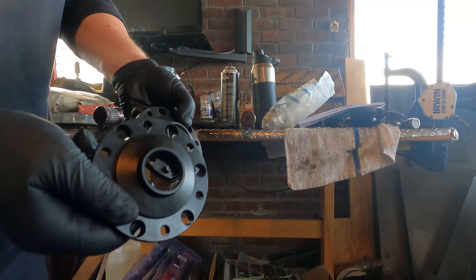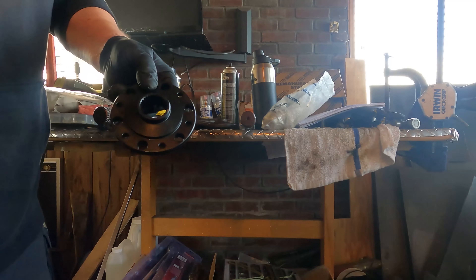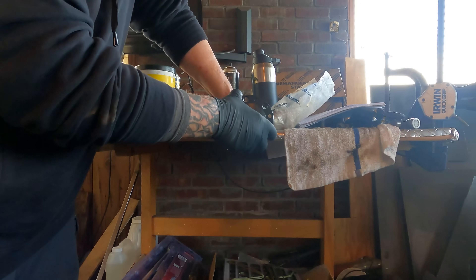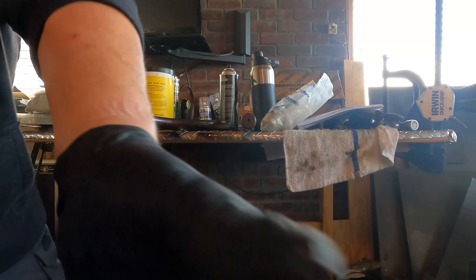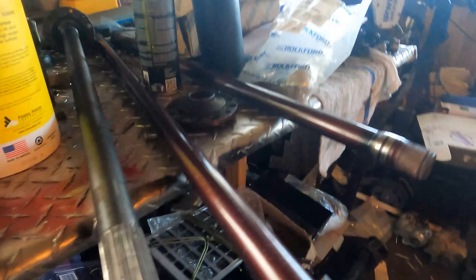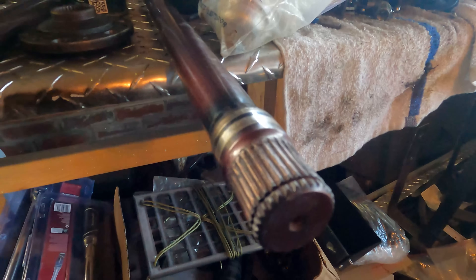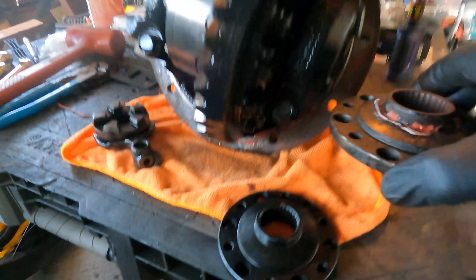Fortunately I had front wheel drive, I pulled my rear driveshaft, and I made it home. But even with this new flange on, I'm not too crazy about these teeth — they're flattened. This is 300M. These are serious money axles, you know what I mean? I twisted the splines and I don't know if I want to put these back on at all. I'm sure RCV will make good on it, but having this point of failure on the vehicle — yeah.